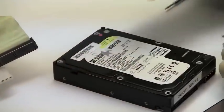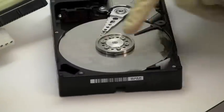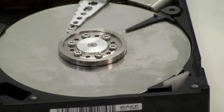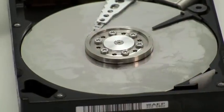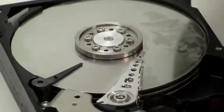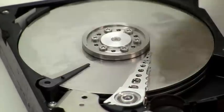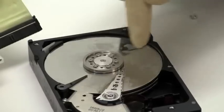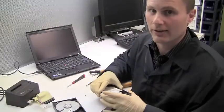You can see that there's already a lot of water forming on this drive. As you can see on the platter surface here, condensation is already starting to form. What that means is, when we power this drive back up, these heads right here — which fly very, very close to the platter surface, nanometers off of the surface — are going to actually drag through the water that's condensed onto the platter surface and score up the very delicate magnetic material on this hard drive.